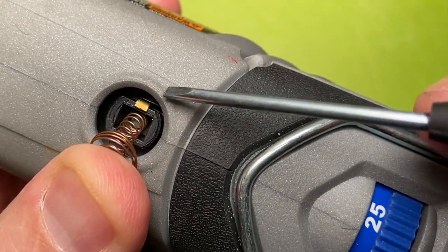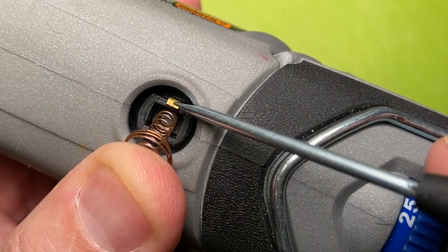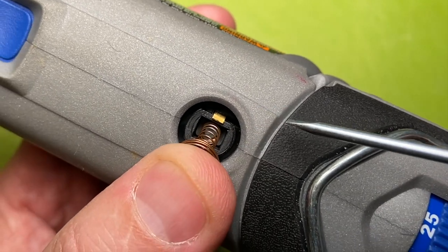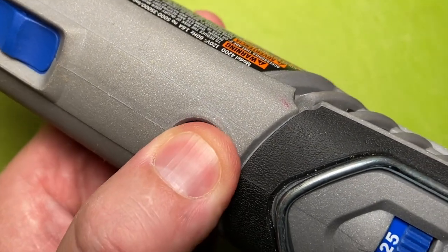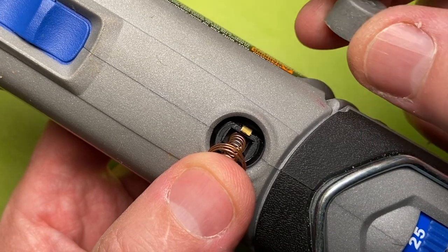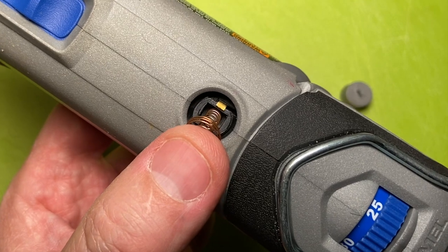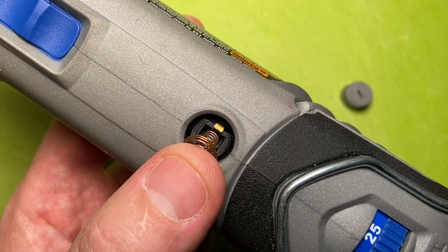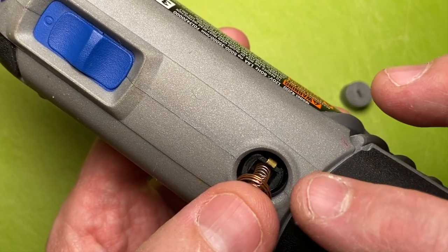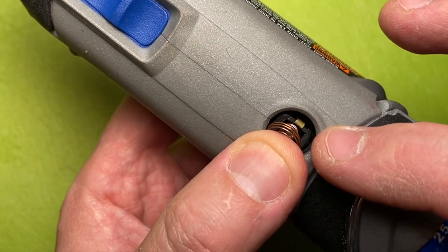One more thing — you can see that little tab right there. Power is actually coming from that connecting to this spring right here. So if that spring is not actually touching that power contact, and this button cover is not sitting right, well, you're going to get no power down inside there. That could very well have been the reason for this — maybe the brush was a little wonky, or maybe this spring was just bounced out and wasn't connecting properly.